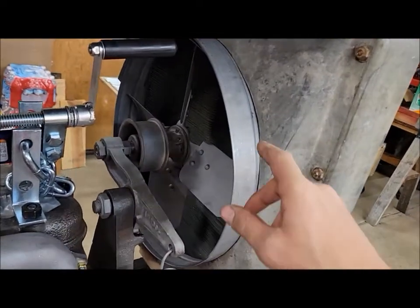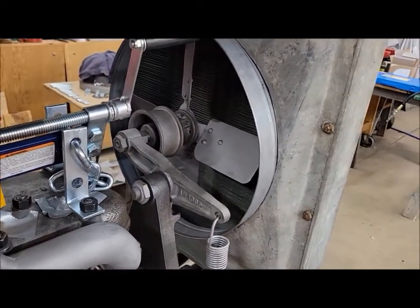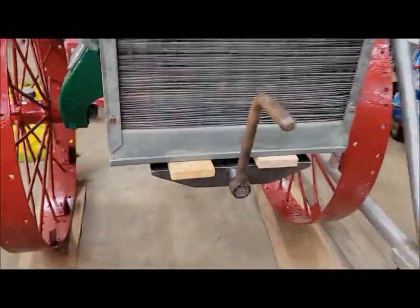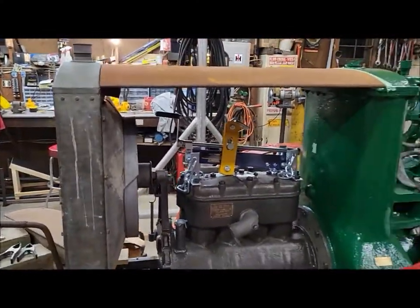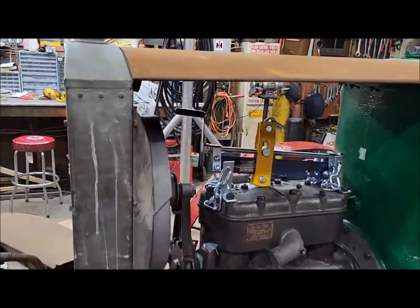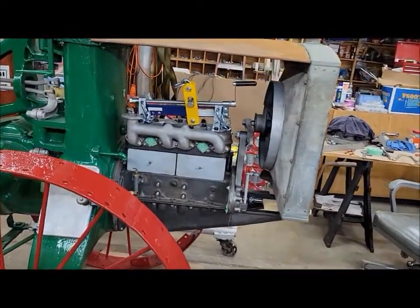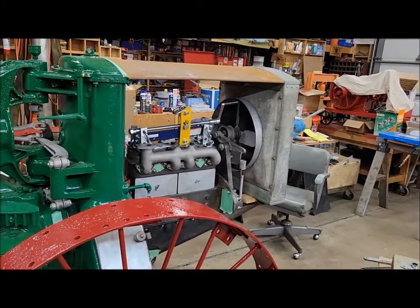I got just kind of in the hole the new lip for the shroud. I was checking to see how the fit of the fan was working. I got it kind of centered up and down. I had to put a couple of 3/4 inch spacers under the radiator to get it to come out that way. And then things are kind of square as far as the hood and radiator go with that spacer. So we'll take a little more look at that later, but for now, at least we're in the ballpark. There'll be a lot of fitting needed. But at least things seem to be coming together. I'll probably see you guys in the morning.